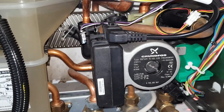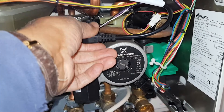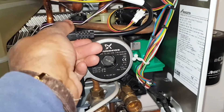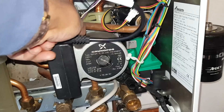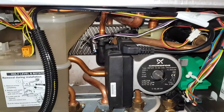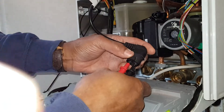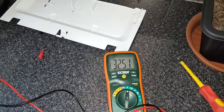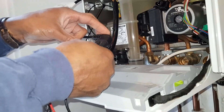The other test you need to do is check if the power comes from the PCB. So we're going to pull this plug off — it's a bit tight — and then use a multimeter to test for voltage. You can see I'm measuring on the multimeter across the plug. So let's look at the multimeter — there's no voltage there. That supply comes from the PCB, and there's no power coming from the PCB, but it should be there all the time.